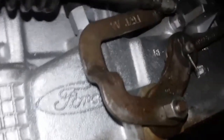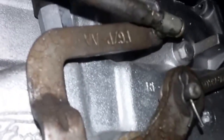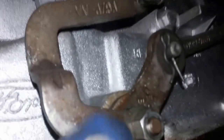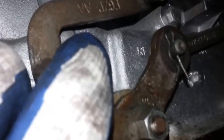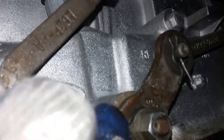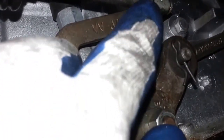You've got a pretty good idea of what to do with the linkage by now — if you're putting together an AOD or if you're converting something older to an AOD. This is my Mach 1 — a '72 Mach 1 — that I converted to AOD. Of course there weren't any AODs until the 1980s, so this is not factory. These are the arms and linkage I used, and this is what it looks like when it's all together and actually working. This is the resting position of the throttle valve arm at no throttle, and when I hit the throttle it pushes forward — that's full throttle. You can see the sweep when using this arm.